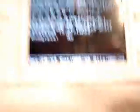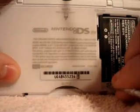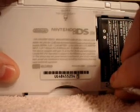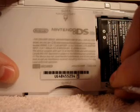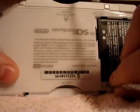You're going to have to press Start. It's going to ask you to press XB to continue, so press that. Now it's going to tell you to short the SL1 jumper and it's going to stay at 0% progress. Take your little toothpick and stick it down in that hole right there. Stick it straight in — don't tilt it. Now keep it going. It's okay if you lose contact; it'll keep being fine.